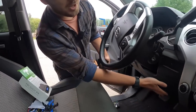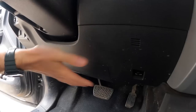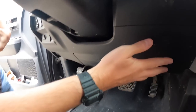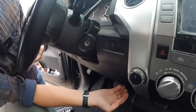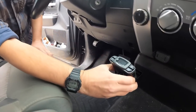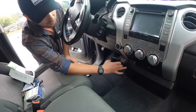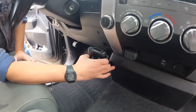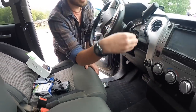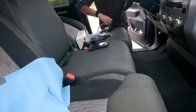In this truck, right here is the SRS knee airbag, so we want to keep clear of that. There's also the TPMS tire pressure reset button we don't want to block. The wires are all behind here, so we'll run the wire down. We're thinking we'll mount it right here — still easy to reach, and the self-tapping screws won't go deep enough to hit anything. It'll be parallel with the direction of travel.